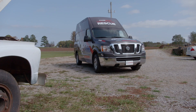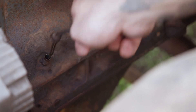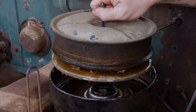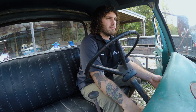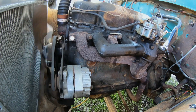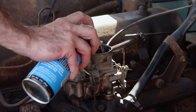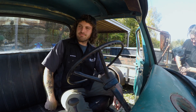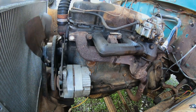As we move the RockAuto van into place, our goal here is just to get it started. In a situation like this, the first thing we'll do is check all the fluids like oil, the air filter, radiator, and wiring. Now, the moment of truth. Not surprising, she didn't start. That's to be expected. We next try spraying starter fluid directly into the carb. Another start attempt — not happening.